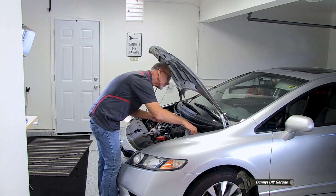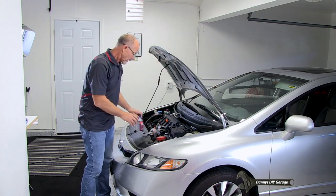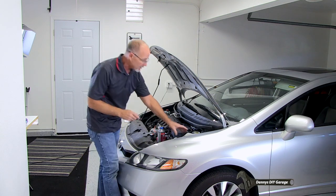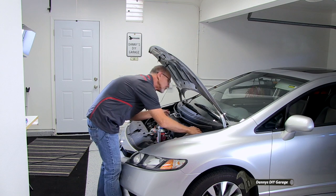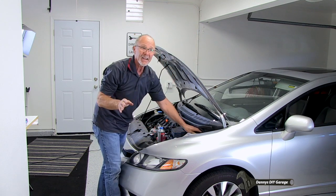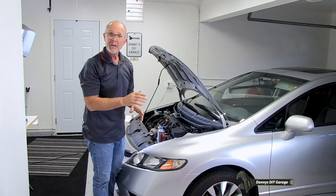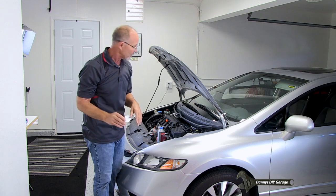The one-man brake bleeder actually worked pretty well. And I'll put a link in the description. I showed you the little trick of how to heat up that hose. So make sure you do that. And if you have an LX with the drum brakes, it's a 5/16 wrench for the rear. But on the EX, it's gonna be a 10 millimeter wrench for the rear.